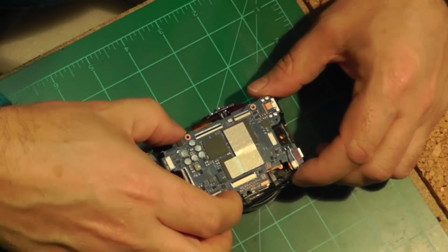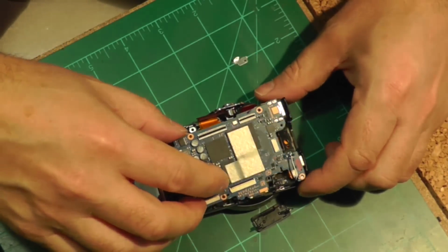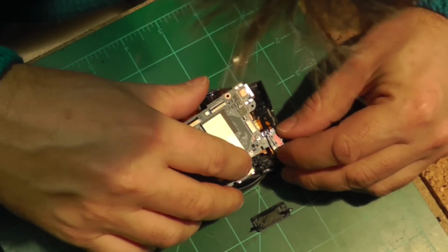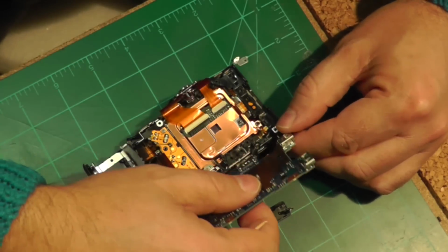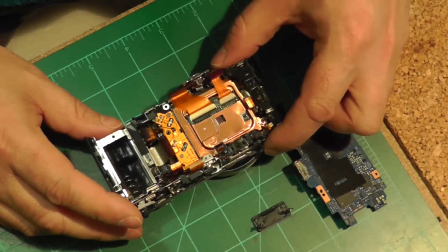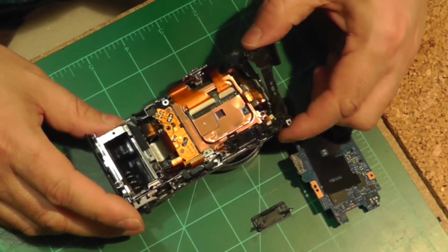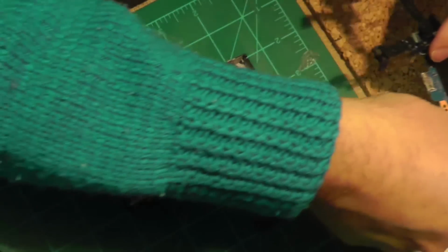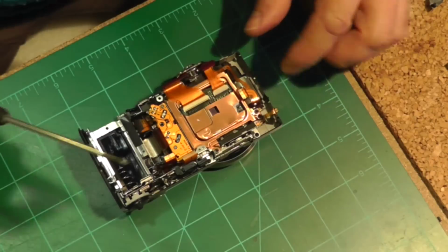And here at this stage, I discovered that there was this slightly hidden ribbon as well, in the corner, that I'll remove in the same way using a toothpick. And you'll see there what at first appears to be two wires that might need desoldering, but not actually, so don't do that. They are just part of that whole assembly, so there's another piece of assembly that you have to remove with that.